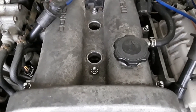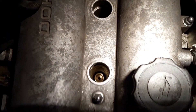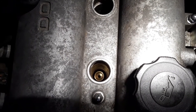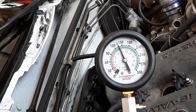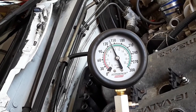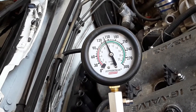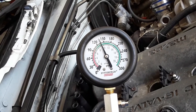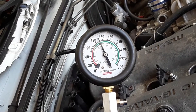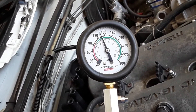Part of our new tool decided to deposit itself down there, so I have to figure out a way to get it out without damaging the head. Every single test ran about 135 psi regardless of whether I opened the throttle or not. It's good for consistency, bad for pressure, but it makes me think something's up with the actual throttle body, which could be explaining why we have a lack of power. So I'm going to investigate that further and I'll let you know.